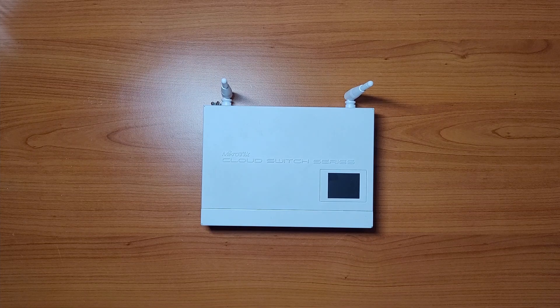Although it may seem like this is just a regular switch, this one has a trick up its sleeve — well, it has two. The first is that this isn't just a switch, it's also a wireless access point. The second is that this one can do layer 3 routing. It isn't very good and is generally not recommended because it doesn't have a very powerful CPU, but you can use it as a simple home router with eight switch ports and Wi-Fi without any problems.